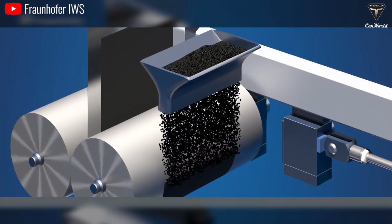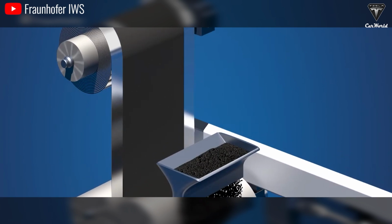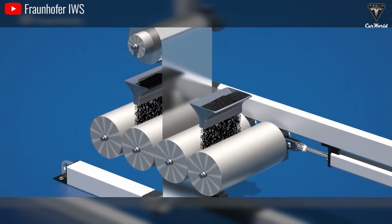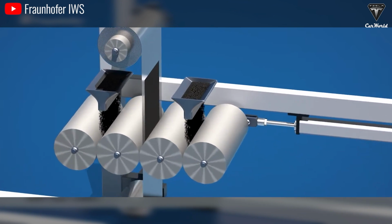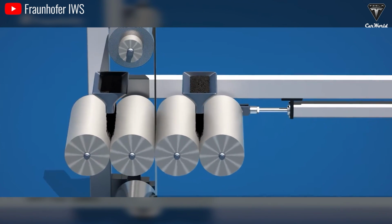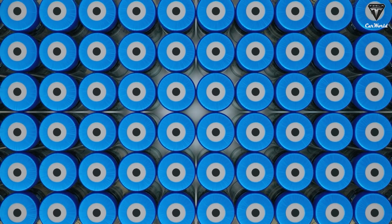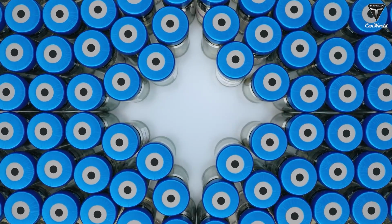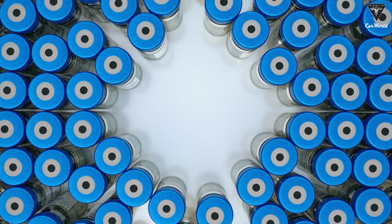However, with the dry cathode process, Tesla is able to remove hundreds of dollars from Cybertruck's cost by improving upon a single component and process. And that is truly a major advancement because not only is Tesla testing the battery cells in a Cybertruck, but they're also making these cathodes on mass production equipment. That means they've successfully achieved mass production of 4680 cathodes using the dry process, and that significantly cuts manufacturing costs compared to the traditional wet process.